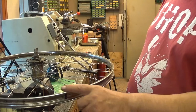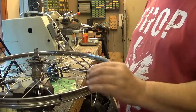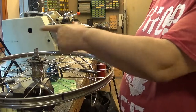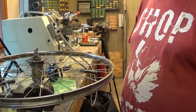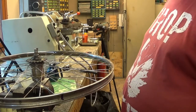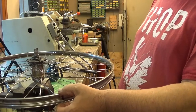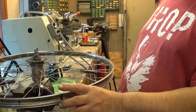And to straighten these edges is really important. Because if they are like that, when you brake, the brake shoes will bind at different places, and the braking effect will be really funny, mildly said. So it can bind here, and it might not be really good. Therefore it's essential that these should be taken away. Fortunately, these are really mild.